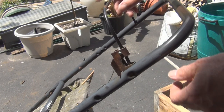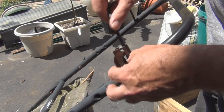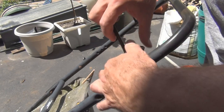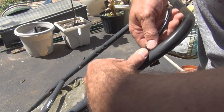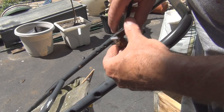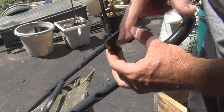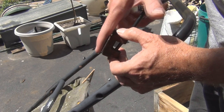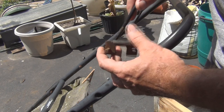This is the engine stop cable. It took me about 15 minutes to figure out because I had disconnected it for so long. It's got this bracket — first off, let's take the cable off. You can see there's this bracket, and I thought I had disconnected it and just looped it on so I wouldn't lose it, but that's actually how it was connected. If you have this bracket, make sure that the flange — or this L-shaped part of the bracket — is facing outward, if that makes any sense.